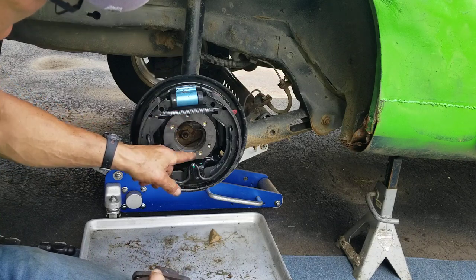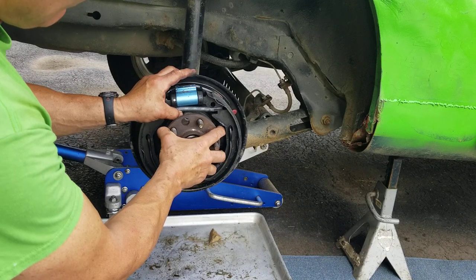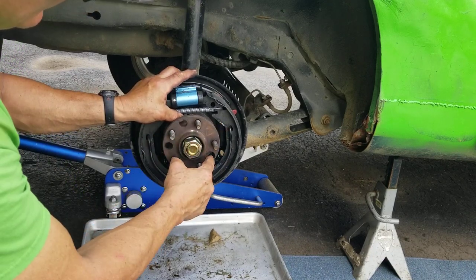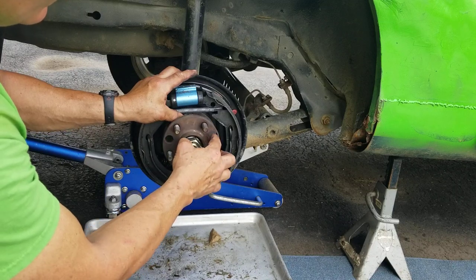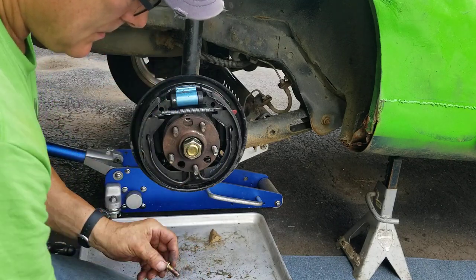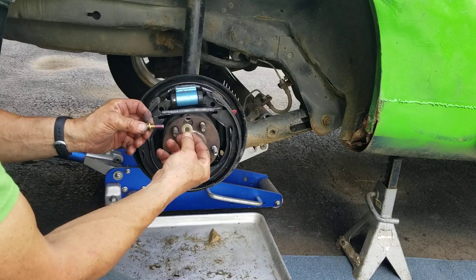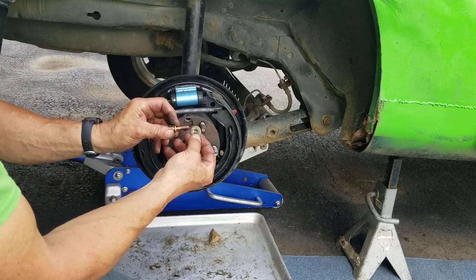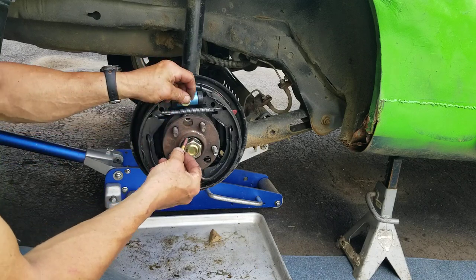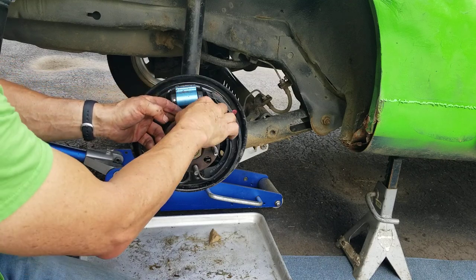We have our three holes for the bearing. Line them up. There's three holes in the bearing flange here. We're going to use the larger one to install the first bolt. Because the washer is bigger than the bolt hole, you can't put the flat washer on the bolt. You have to put the lock washer on, set the flat washer behind, and feed the bolt through the flat washer and into the hole.